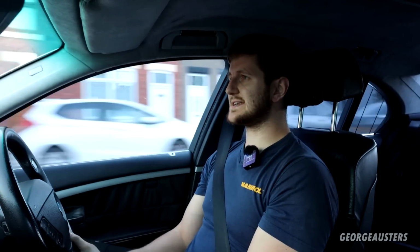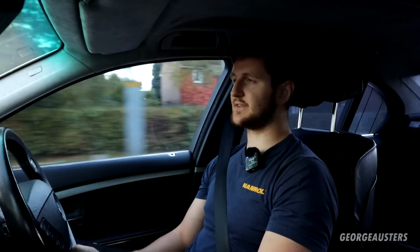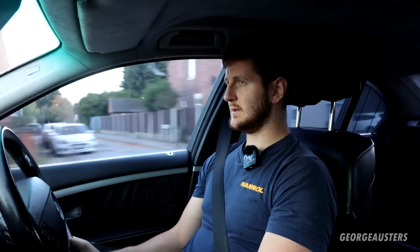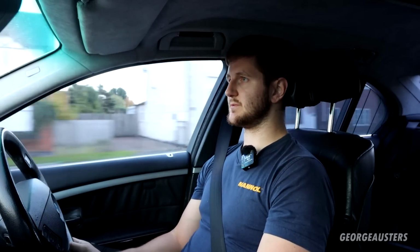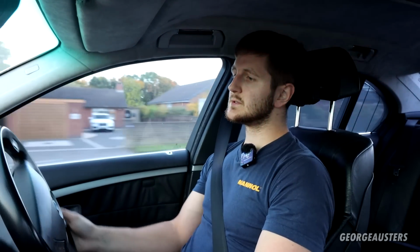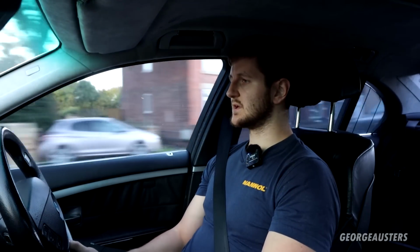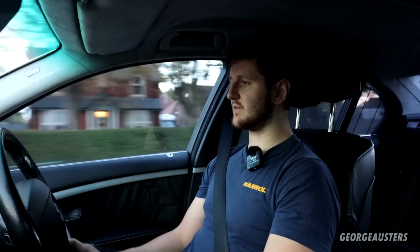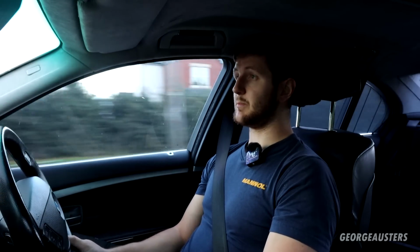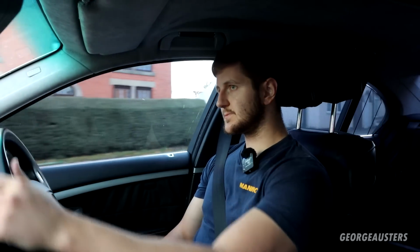Now, I don't really trust that enough to say, oh, okay, you can floor it right to 7,000 RPM now. I'd still rather wait a good 15-20 minutes before I do that, because there's nothing worse than revving out your engine on a cold one. So we'll just do 15-20 minutes of steady driving, keeping the revs below 2,000-3,000, and then we'll put our foot down, and I'm guessing that's when, if any, we'll notice any issues.